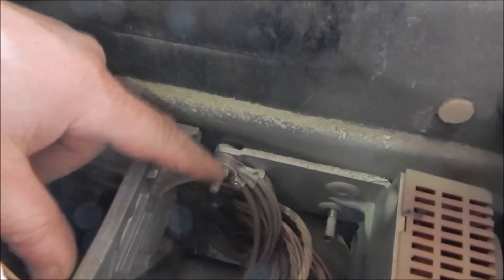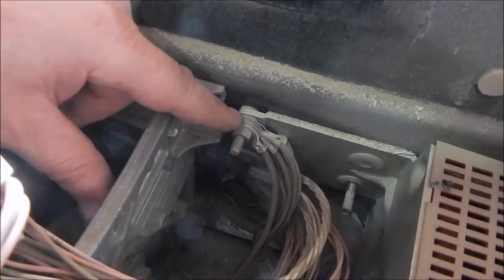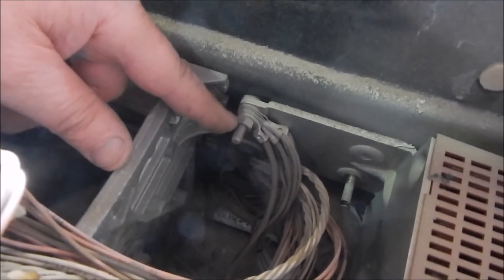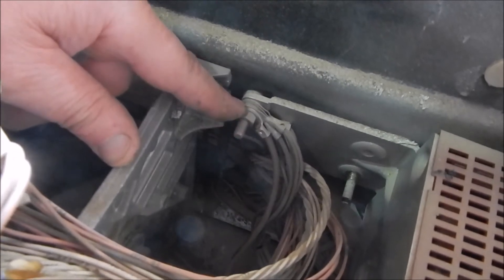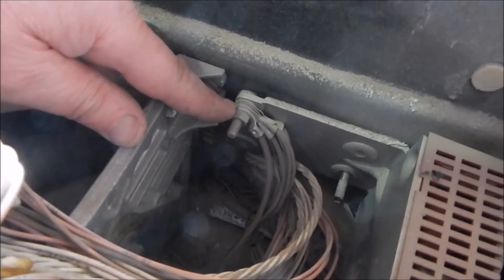When you've got cables — and you'll see later — power cables on the CE panel together like that, what I do is I take them off and throw a cable tie through them, and then you know all of those will be together. You'll see later when I strip the loom that some of these I will be replacing with the new loom, and some will come back onto this post. I'll pull them off, put a cable tie through them, and then put a label on them.